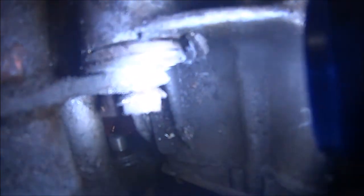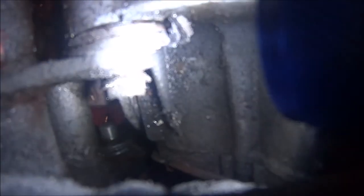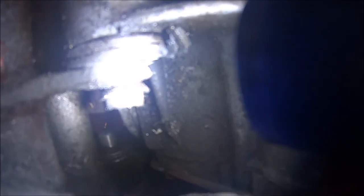I don't know if you can see that. After about 10-12 minutes, that's how far I've got. So what I'm going to try and do now is get the socket back on the bolt, move it around a bit, let the Dremel cool down, and then do another 10 minutes. If I can get the engine past this bracket, I should be able to get the engine out - and with the engine out, I'll have a lot more options with that bolt. At the moment I can't get to it at all. I've got a new one of these rubber bushes, so carry on regardless.